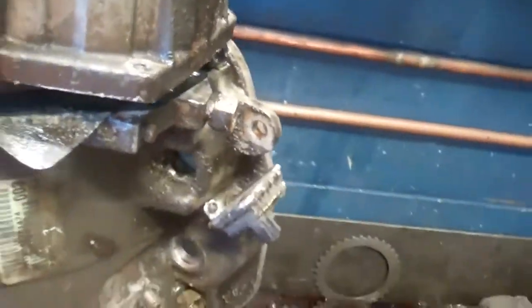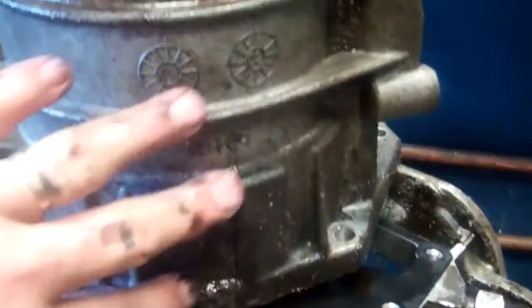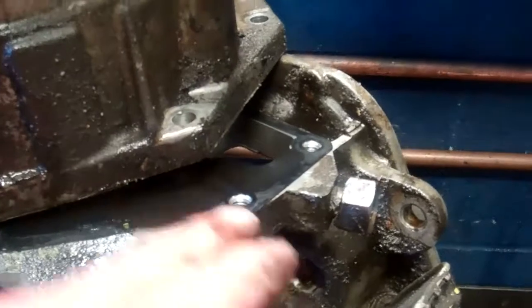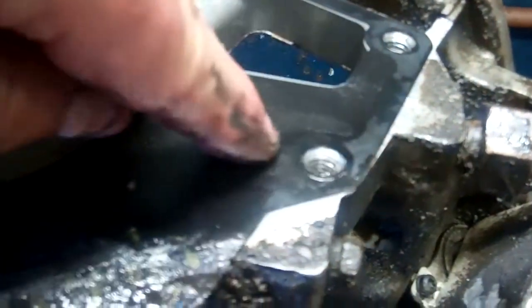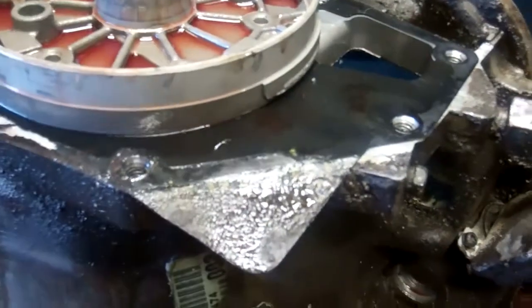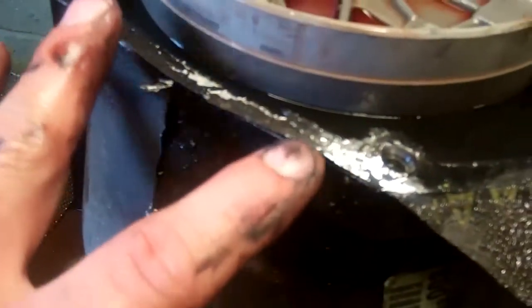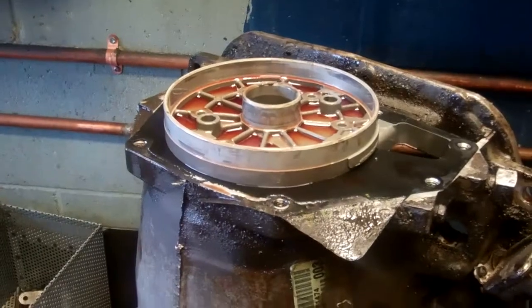We first thought that the overdrive housing, which is this, was cracked because it was all wet on top of here, and it's coated the side of the transmission. This is the driver's side of the transmission, but when taking it apart, we noticed that the gasket is deteriorated. So if you can see, there's spaces in there. That gasket should look like this all the way to the edge. So what we first thought was a problem with the housing being cracked does actually look a lot more like the gasket itself is deteriorated. It was probably leaking through this gasket, which this is on the top there, but this gasket situation is not a normal condition. That's something that we just don't see very much of.